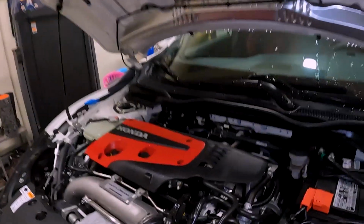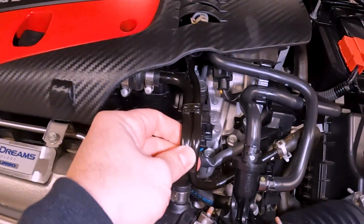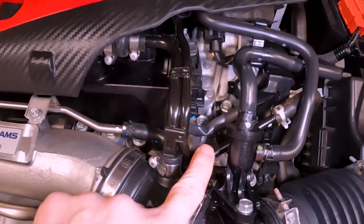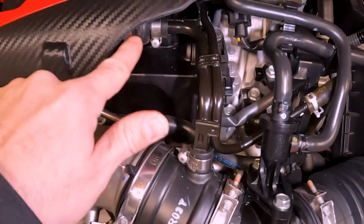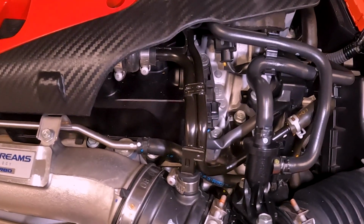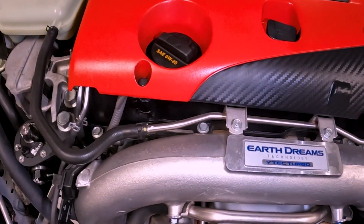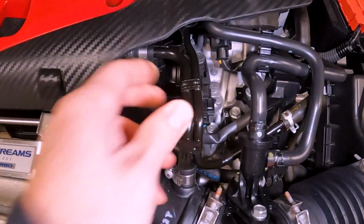It's day 2. There's, like I said, more to do than what I pictured, having to do with some coolant lines. Actually, really quick, mainly this kind of dual hard line setup right here. This is kind of interesting. Some of this is coolant and some of it is a vent to the intake. As you can see, this is the coolant right here on the right, and then this is that vent from the valve cover to the intake for the crankcase. And then you're also making use of these two mounting locations to take the coolant back over here, because you are taking this out for it.